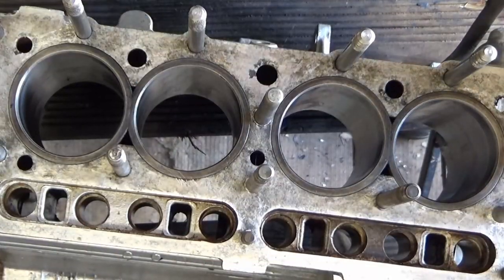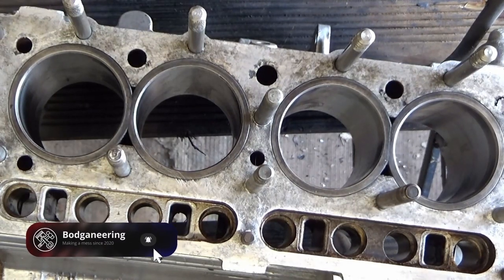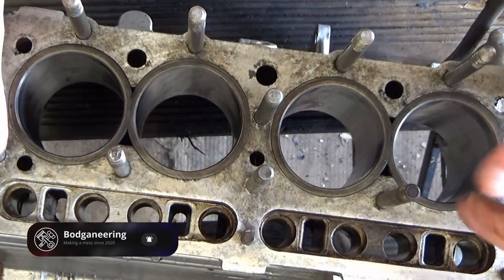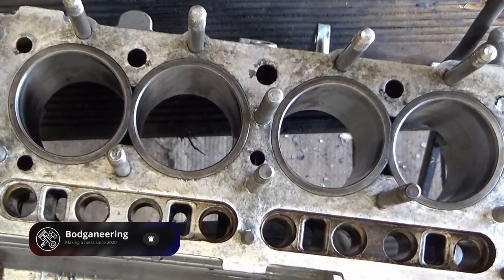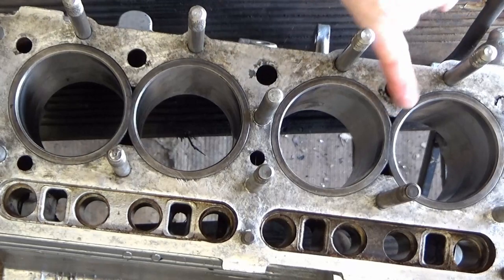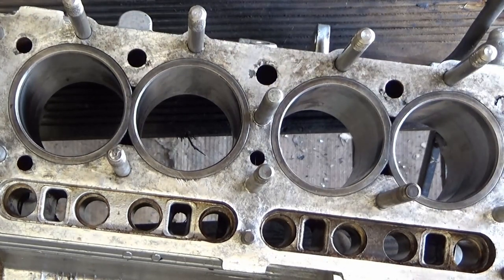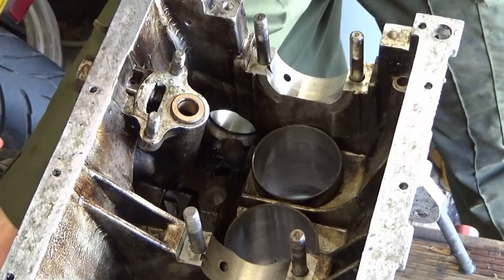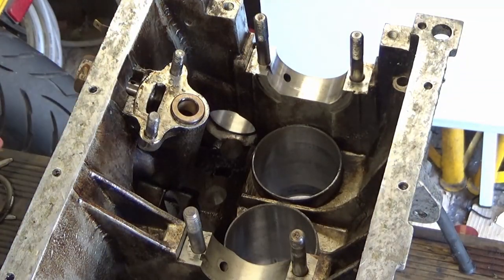As you've seen from my introduction, I have cleaned it all out. There's a lot of crap in there so hopefully it's got rid of all the gunk and stuff that was blocking it all up. Cleaned all the faces up. There's a bit of pitting around there but it's outside of the gasket areas, so let's get the engine back together. I've been through and measured everything up on the engine and it is really, really tight still, which is excellent - I'm very surprised.